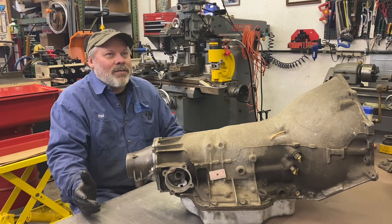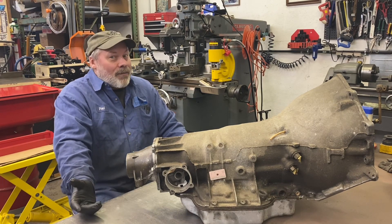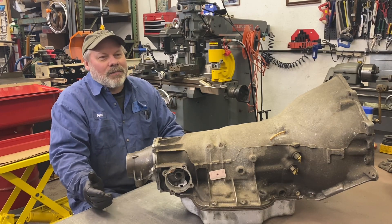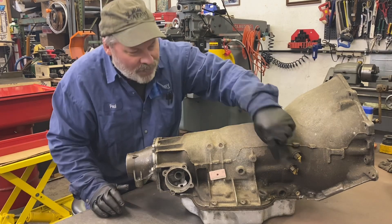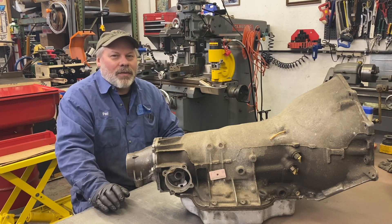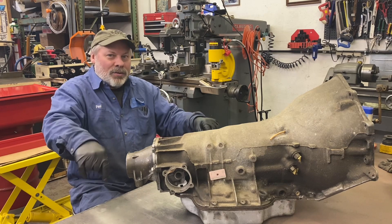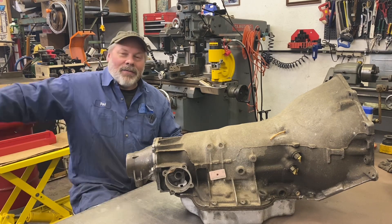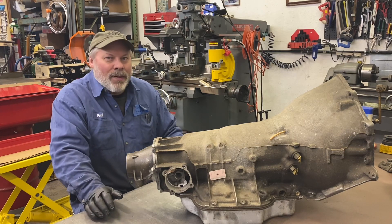As late as maybe a month and a half ago, a guy was bringing a transmission to my shop. Somebody else had put it in his truck for him. It was facing tailgate-forward, still full of oil — that's the way they pulled it out. Nothing: no spare yoke stuck in the transmission, nothing in the dipstick hole. When the wind in the back of the truck goes over that open hole, it will suck all the fluid out of it — which it did — into the bed of his brand new, less than a year old diesel Ford. It was dripping down through the drain holes near the cab onto the particulate filter on the exhaust, and he was pretty sure his truck was going to catch fire. I still have a giant puddle in my driveway that I've cleaned up — I'm putting dirt on it and scrubbing it — but I'm still not too happy about it, and it doesn't have to happen.